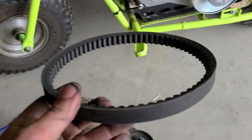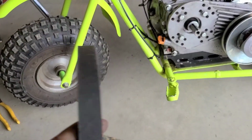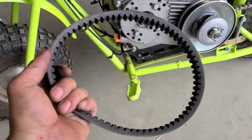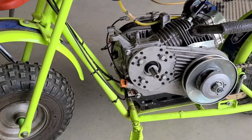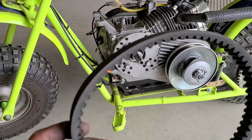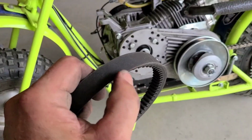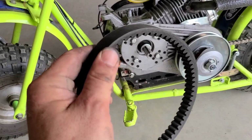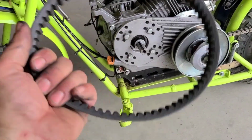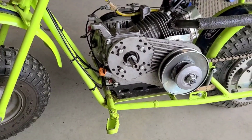With our belt, it might be a new motor, but it's the same torque converter, okay guys? So this belt has already been used on this driver. Its best chances at life are to continue running it on this driver. You switch this to another combination or another series of pressure plates, it only takes a little bit to be off, and you'll wear that outside edge quicker and get less of a second life, if that makes sense. So it's still on its original life. We're just going to continue it right here.